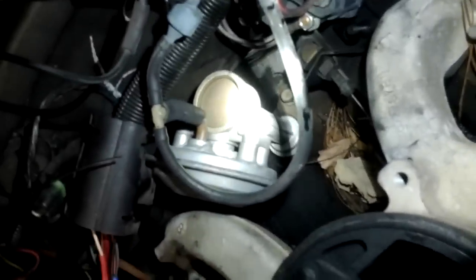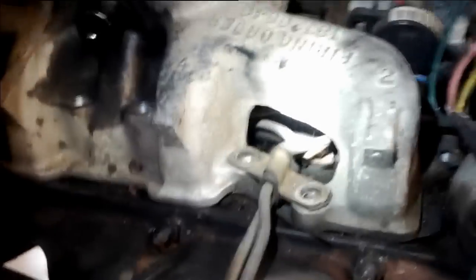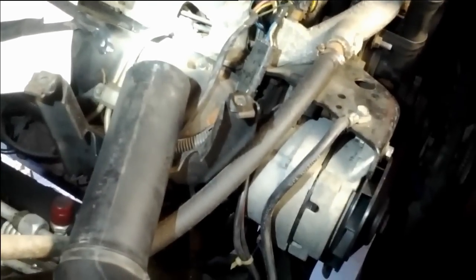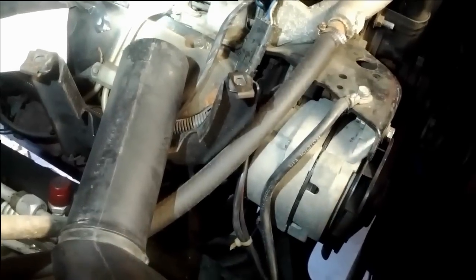I've got to move this — I guess I have to move that bolt right there so I can spin the vacuum pump out of the way. Better get that back bolt first just to make sure. All the bolts are out on both sides now. The tricky bit — at least when I had it at the junkyard — is just trying to get these clips out of the way, slide them off. I need some pliers without bending them so horribly I can't use them again. I took ones from the junkyard Suburban just in case but mangled them pretty good. Once I get those off, the intake should break free.